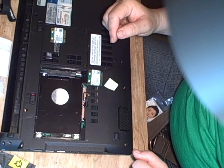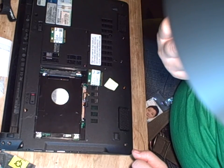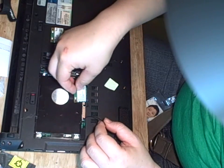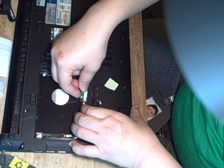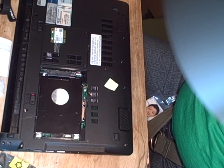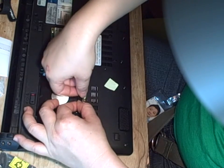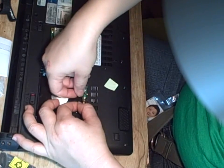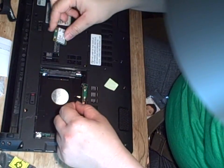Let me look at the revision number: 256A03A04, MAC address. Yeah, this one has a MAC address on it — it's the working system pull. I have to kind of lift the plastic up a little bit before I'm able to plug it in. Once you've done that, plug in the little antenna number one on the card, as specified.